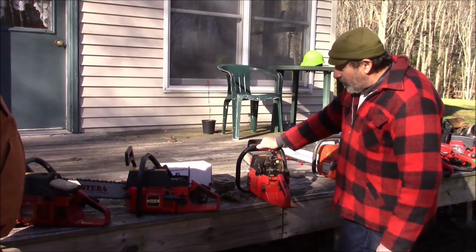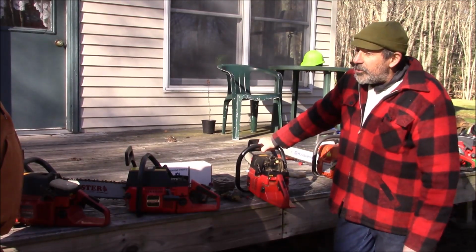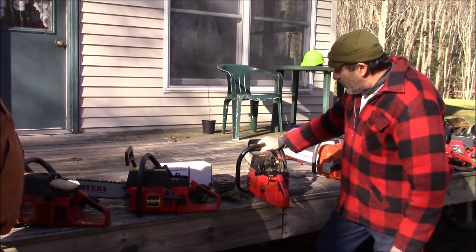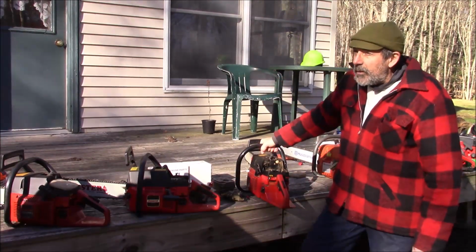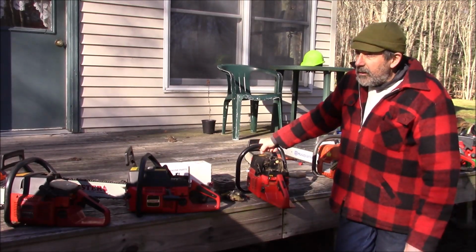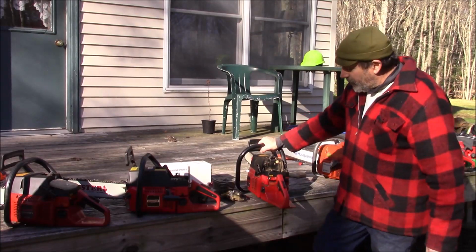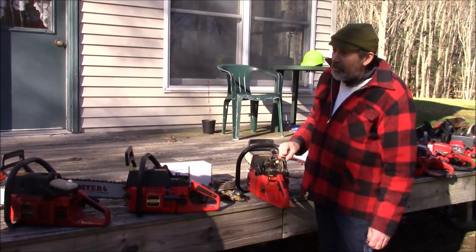Yeah, I think, you know, here again, we're assuming that you got a carb that's okay. Right. So say you got a saw, maybe there's nothing wrong with it, the carb is junk. What you could do is find a carb that may have been from a Husky, and you can migrate all these different things over there. Pull the little shaft out. Problem is, you know, Tillotson's out of business now. So you could still order carburetors for Husky 61s and 272s and all that, but they're sending you Walbros now. So now you have a different set of parameters because you don't have a Tillotson at all. So it's not necessarily a bolt right in.